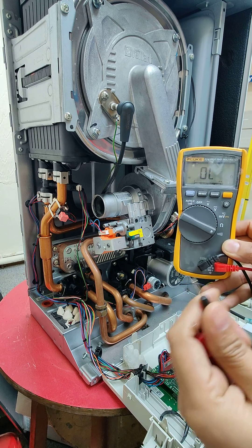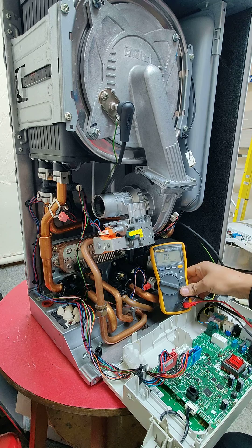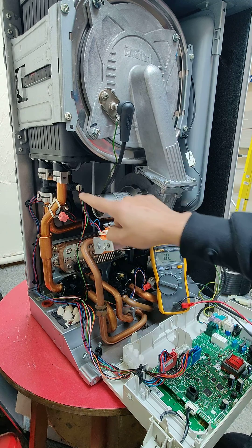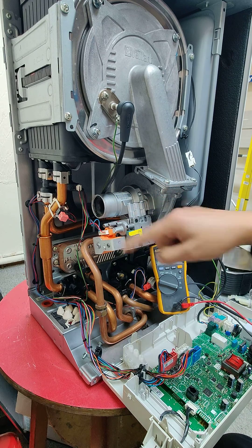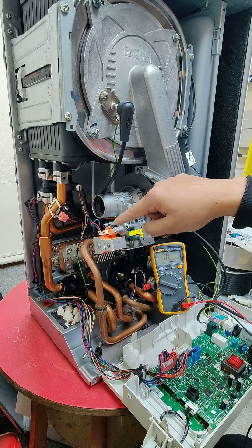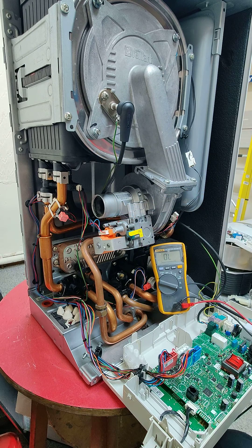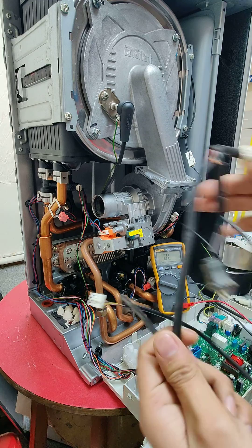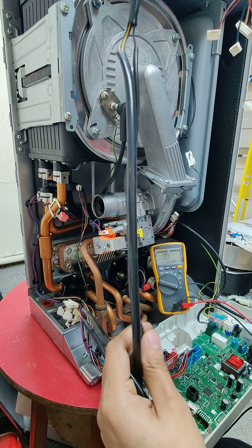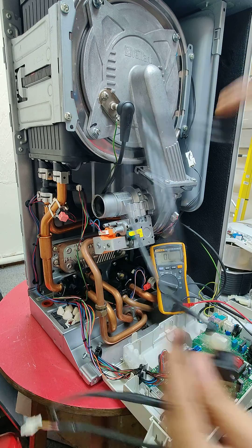Now that the meter is set to the correct setting, depending on what we want to check, in many cases we want to check our wiring harness — in particular going between NTCs or gas valves and the board. The very first thing we need to do is trace where that cable is going. In some cases it can be quite difficult because some wiring harnesses are wrapped. Majority of wiring harnesses are in a sleeve like this, so it does become a bit difficult to trace because you can't put your finger on it and say that cable goes from here to there.